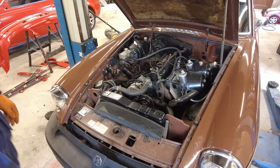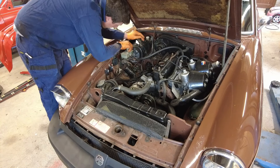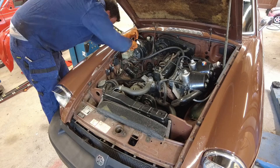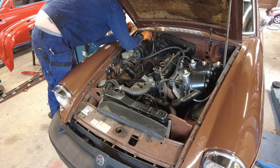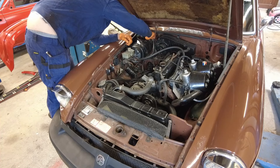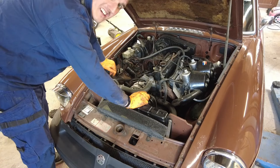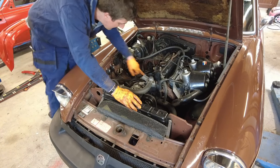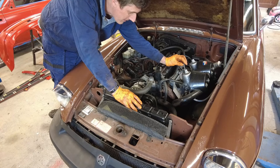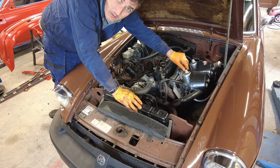Looking at the top side of the engine, we're going to check our fluids' condition as well as levels. Brake fluid looking all right, and clutch fluid — there's a hydraulic clutch in this — plenty in that as well. I only did this last year, so there are about 3,000 miles on since then. Technically I don't need to change the oil now, but because the car had been sitting up for so long before I got it, it seems sensible to do so. A little trick: write the date and current mileage on top of the filter so you have a record of when it was last done. Checking the level of oil in the dashpots as well — I'll need to top them up; you can use engine oil.